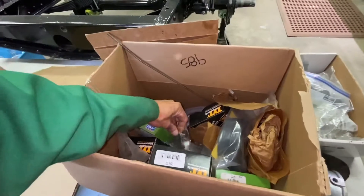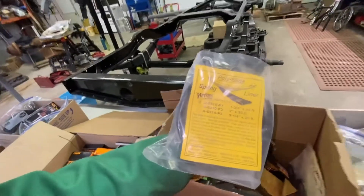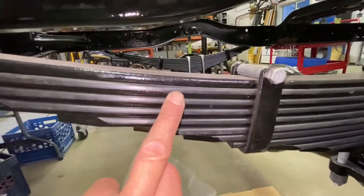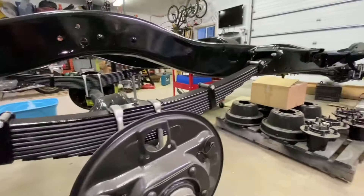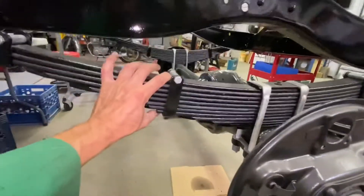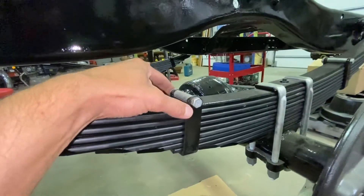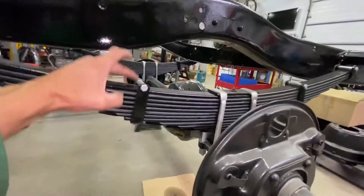There are some bearing parts in here. These are bearing parts and this is a poly slide — I installed this poly slide in between all of the leaf springs so I don't get that squeaking noise. It did raise the spring thickness slightly and I was a bit concerned because these ended up just fitting on the leaf spring. We'll see what happens as things compress — technically it will lengthen out and create some room there. Just a little tidbit of information.